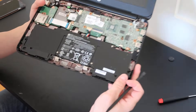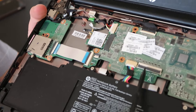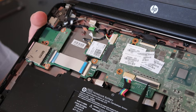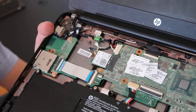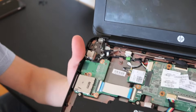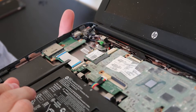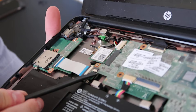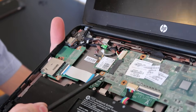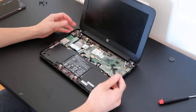Now I'll show you the ribbon cable connectors in here. You have this one and this one — they look a little different but work the same way. There's a little plastic ZIF clip: it snaps down to secure the ribbon cable and pops up to release it. Right now it's snapped down, so you take your pry tool and pop it up. Make sure to put those clips back down after, because they break very easily and can be nearly impossible to find replacements for.